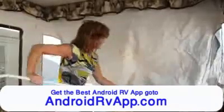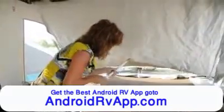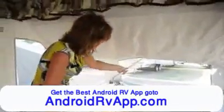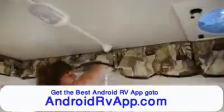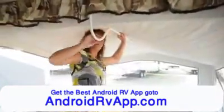Next, you're going to be putting your tent ends up. The first thing you need to get is this pull, which is generally found stored underneath your mattress. The end has a clip — you take this, find your end bar, and snap it between the two screws. You'll push this out and get it into position. Sometimes this gets a little bit tight, so what I like to do is release the pull so it's easily forced in and out, then connect it into this area here. You push your button in and put your pull into place. Now you just need to set it — pull — and now it's perfectly secure. Your tent ends are up.